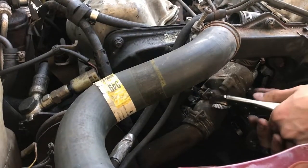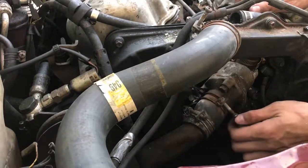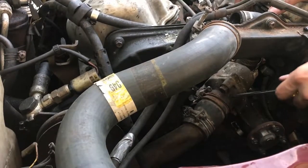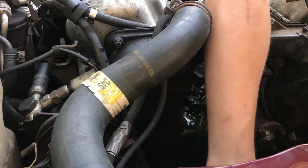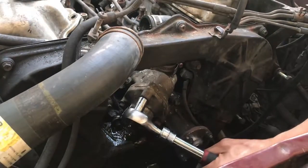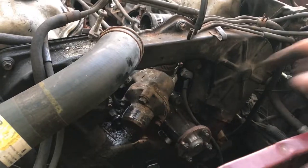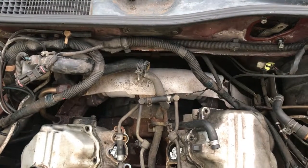I really dislike this type of clamp, so I'll be replacing it with traditional hose clamps. I'll remove the silicone hose and cut it off. Next, I'll be removing all of the bolts on the thermostat housing, which are all 12 millimeter. That last bolt will need a wrench to access. I just realized that if I'm going to take the engine out of the car, it'll be much easier with the engine on a stand, so I'll leave this as it is for now. The first thing I'll do is remove all the bolts that hold the heat shield on the exhaust crossover tube — all 12 millimeter.